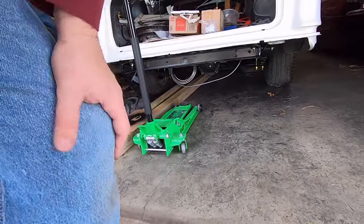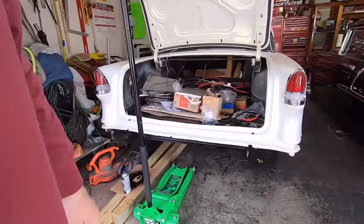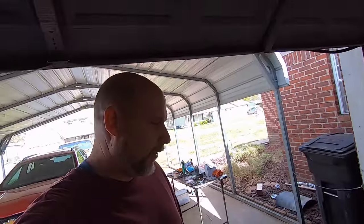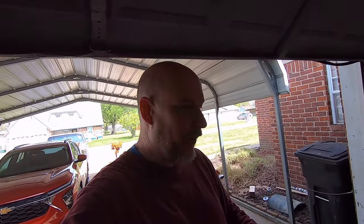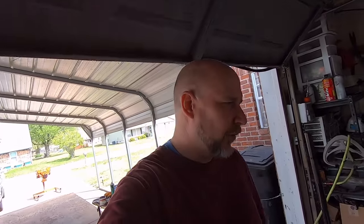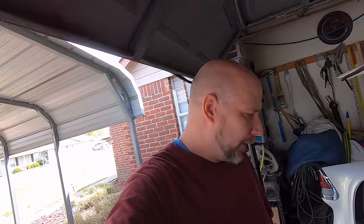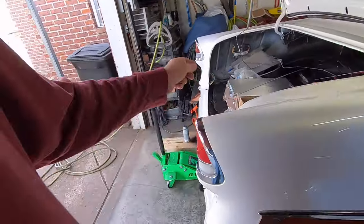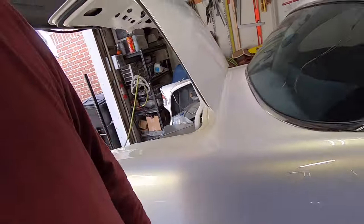I got the gas tank in the car and bolted in. The only thing left is cutting the fuel line, flaring it, and bolting it to the sending unit. I want to get the front suspension on, put it on ramps, then get under there and do that — right now it's too low to the ground to use a flaring tool comfortably. I did put his taillight assembly back in since I had it out when I coated the trunk.